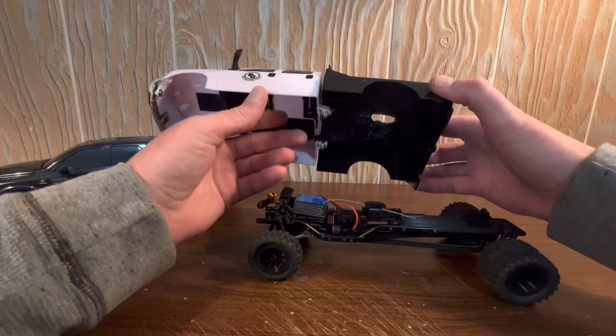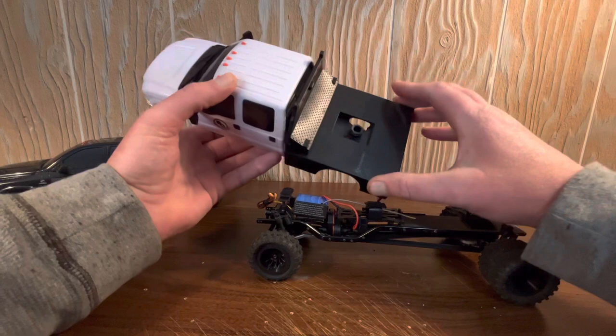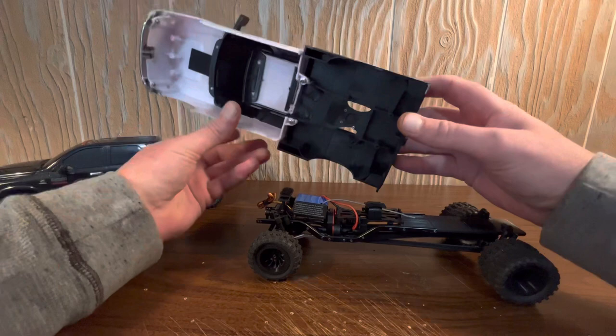So this is attached a little differently than on the Chevy and the Dodge. All I ended up doing was putting some glue on the bottom of this round piece that your gooseneck trailer goes down into. Once I got it down in there, I let the glue dry for a minute, and then I drilled holes in it, ran some screws through it, and put some nuts on the backside to make sure that it stayed in place. But yeah, just be aware of that if you happen to get the Ford and do some cutting.